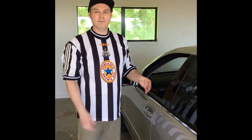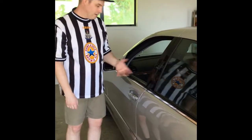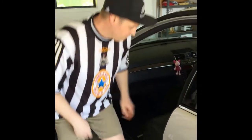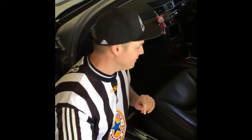That vacuum pump creates the vacuum that activates your central locking for your boot and for your door locks. But if you're trying to find a leak in that system, you'll struggle. So this is the first thing to try. What I found out this week is that the vacuum pump also pumps up the lumbar support for the seat system. And so if we've got a leak, the cheapest first thing to do is to turn these seats off.